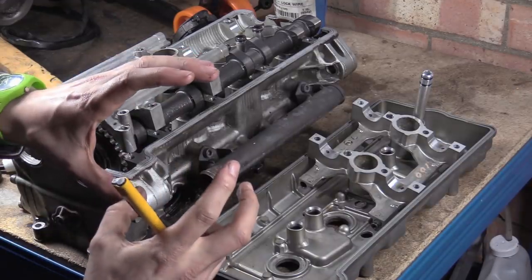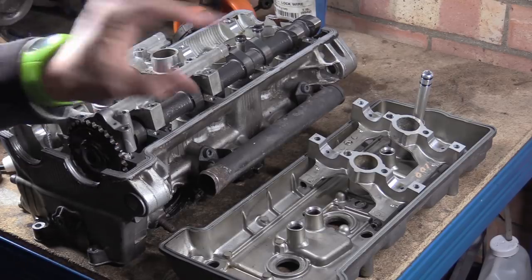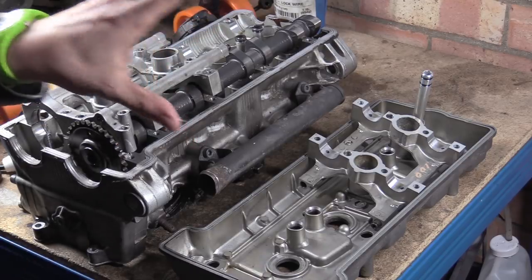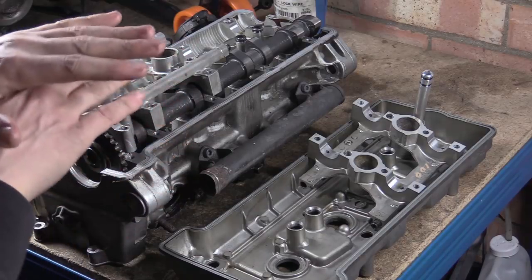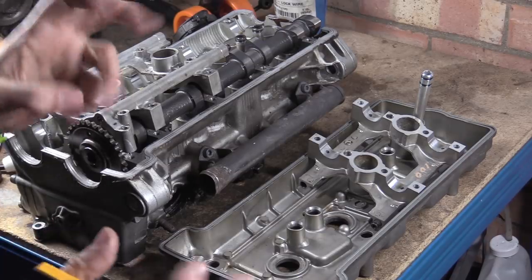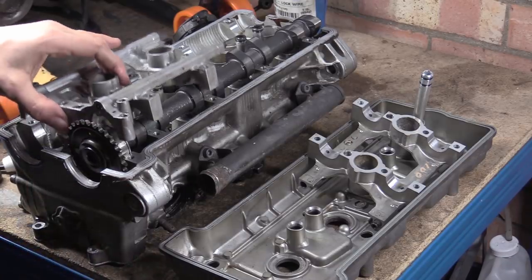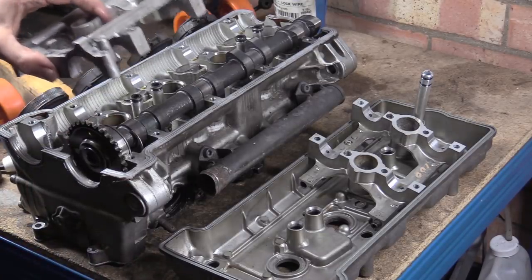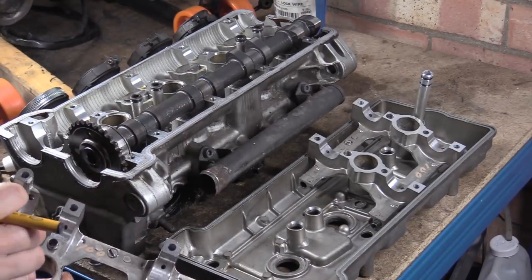As soon as the cam starts to go up, that restricts that hole, which means the oil pressure goes up locally and propagates from there. It's hydrodynamic, so it's trying to resist that, because oil is incompressible, to a degree. Because of that, this cam is trying to lift up. It is always trying to lift up.